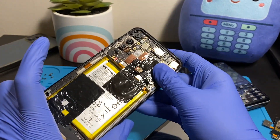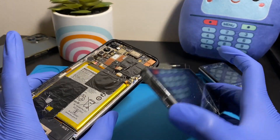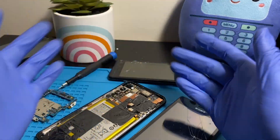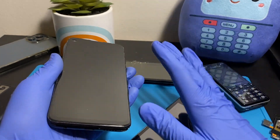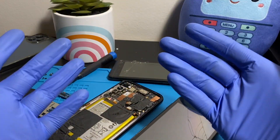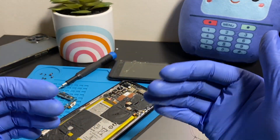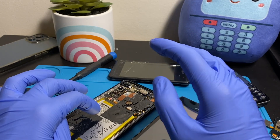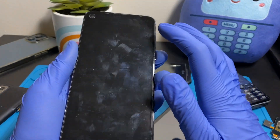Don't trust the phone after more than two days of water damage. Of course, I bought these water-damaged phones secondhand and don't rely on them daily — if one fails, I'm not worried because I don't have important data on them. But you might. So two days is a good limit. How fast you reacted and how fast the phone was cleaned out matters. Less than two days: may need some parts replaced but the phone should work. More than two days: get another phone — your data is worth more than a new phone.